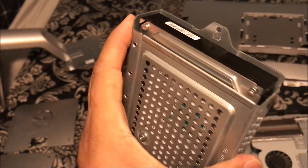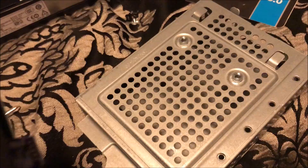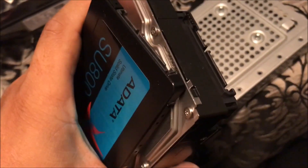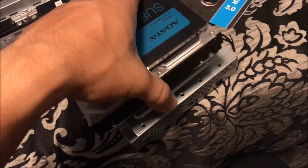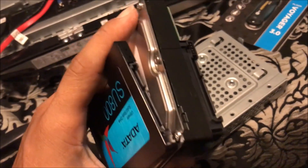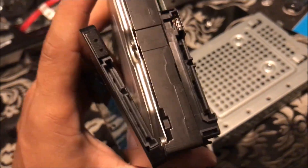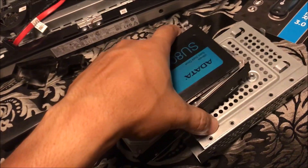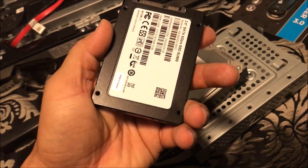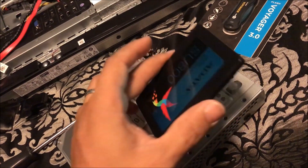Now you have the hard drive and can take it out of the metal shell. The hard drive is held by Phillips screws from the sides at each of the four corners. Slide it out, and when you put the new SSD in, just make sure it's facing the same way. I would put double-sided tape on the bottom and stick it in the housing.